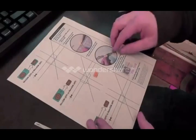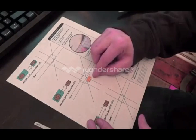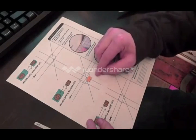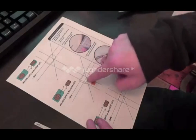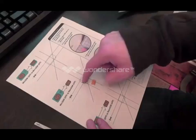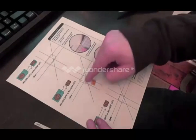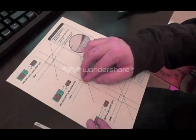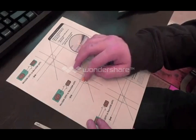So when you're cutting all the way down to a nano SIM like this, you're basically just cutting around the contact point, the metallic portion of the card. There's really no plastic left when you're finished. And when you're looking at your diagram, the innermost square, this little tiny portion in here, is what you actually need to end up with. And as you can see here with my cut, it fits in there perfectly, or maybe you can't see that, but anyway, it fits in there perfectly.